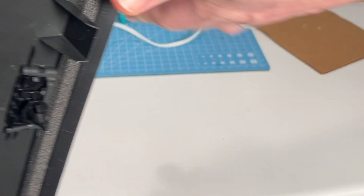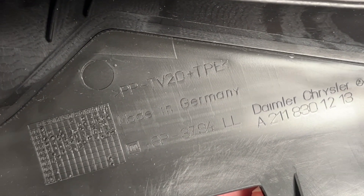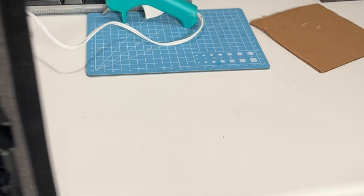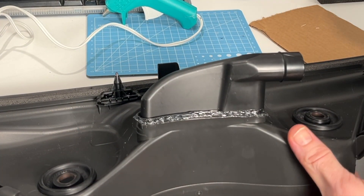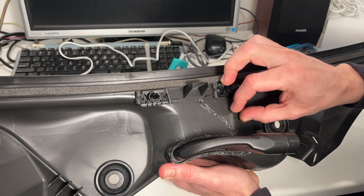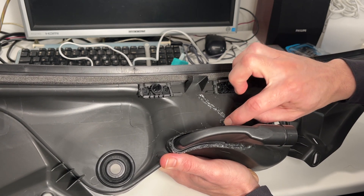Let's see if we can give you a look at the label on this. Above 'Made in Germany' it tells you the type of plastic — and that's what had us wondering: would we be able to glue it? We researched the type of plastic and saw a lot of information saying you have to use these special, expensive adhesives. We thought, we've got some hot glue around the house. We had already plastic welded another part, so we knew it would work fairly well. Here you can see where we've also glued onto a crack in the piece — that seemed to work pretty well too, although the crack is in a challenging spot. The seam around that drain seemed to work a little bit better.